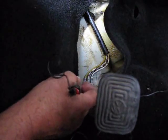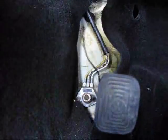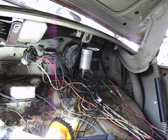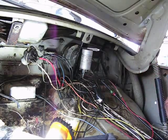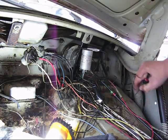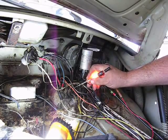I'll put a little WD-40 on that, wiggle it around, go to the headlights and work from there. Back under the hood — remember what I said about the yellow wire. The yellow wire runs out of here, probably from the dimmer switch, right up to the fuse box. I've got fire here, but I don't have it at the headlight bucket.